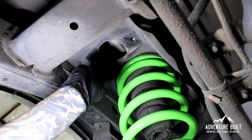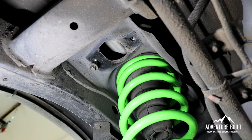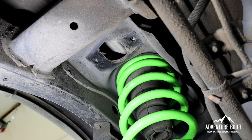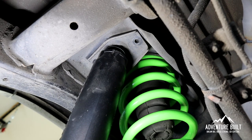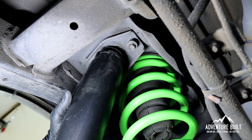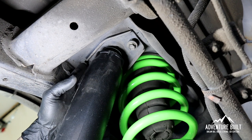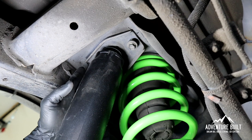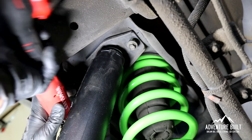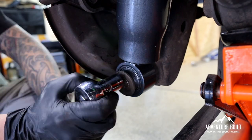On the plate, one side is notched, so I'm going to install the outside towards-the-frame bolt first. The easiest way — this was the third try — put the shock in a little bit, angle it towards the inside towards the drivetrain, and get the slotted bolt in first, because I could not get that in with the inside bolt already installed. Once you've got the slotted one in, you can index the inside bolt and it's much, much easier. Tighten it all down with a 17-mil socket.